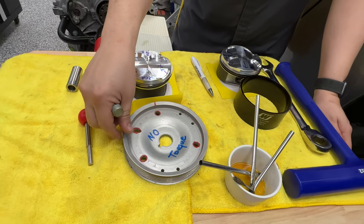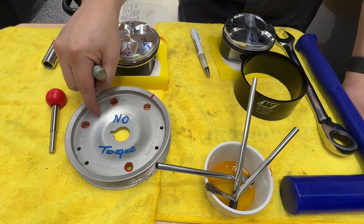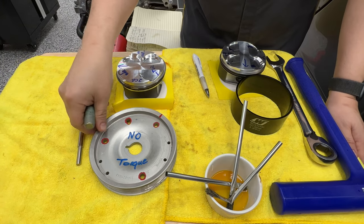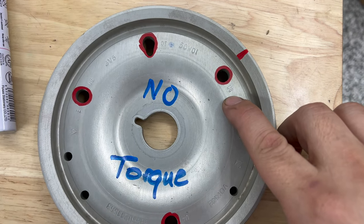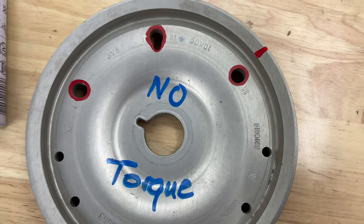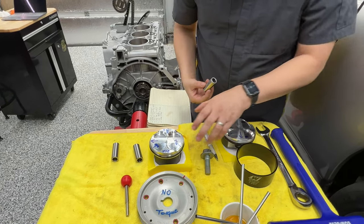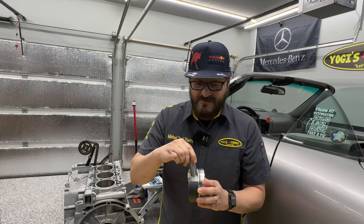Alright, so here's your pulley - and yes, I did use my awesome ultrasonic cleaner on that. If you haven't seen that, be sure to click the pop-up above and check the link in the description below. I've got a crank pulley here and there are a couple of things I wrote on there. This oval circle puts the piston at the lowest position - the most optimal position of where we're going to be able to ram this wrist pin into this piston from the inside. There's no take-backs - this has got to fit in here.